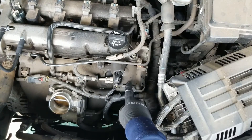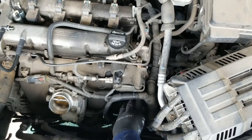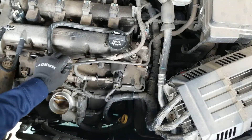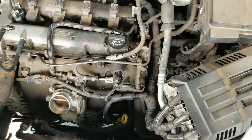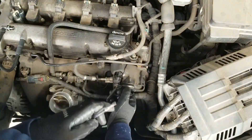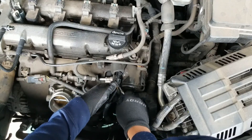This is the fuel pump — this is what we're going to take. There's the intake for it; the fuel pump comes from the tank, and then at the bottom there's the discharge side from the pump, called the high pressure side. We've got a bunch of wiring harnesses to disconnect. There's the wire connection plug to the high pressure pump. Sometimes it gets tricky — find the little clip that holds it in place, the little lift-off tab. Lift up on the little tab, pull the plug, and voila.